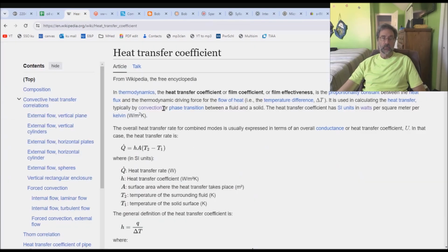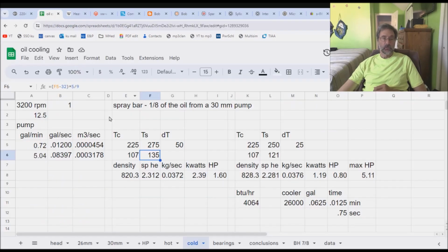It is this one. It's called the heat transfer coefficient. You see this thing called A right there. You can't really read it. It's just more like a picture than it is text. But anyway, the A represents area. And this is kind of an experimental-based constant that tells you how well that particular area is used for heat transfer. And of course, there's the standard temperature differential. What we need to focus on is the area. So let's go back over to here.